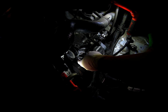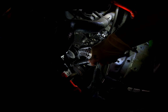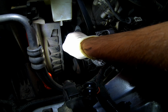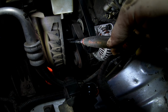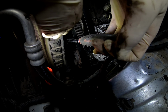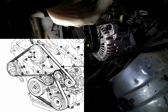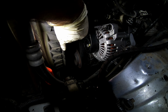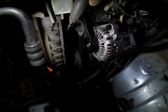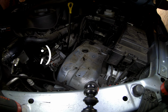Okay, once you've reached this step and you tighten these buggers back up, everything is pretty straightforward. You go back the same way you came, make sure everything's connected, everything's secured, make sure to route the belt properly. If you do need the diagram for this vehicle, the wiring, my apologies, if you need the serpentine belt diagram for this vehicle, leave a comment and I will post it. Or if I can find it before finishing this, then I will actually try to stick it on here. That way everybody has it.